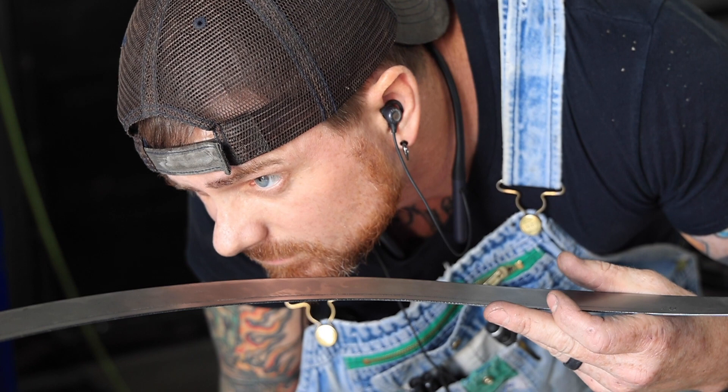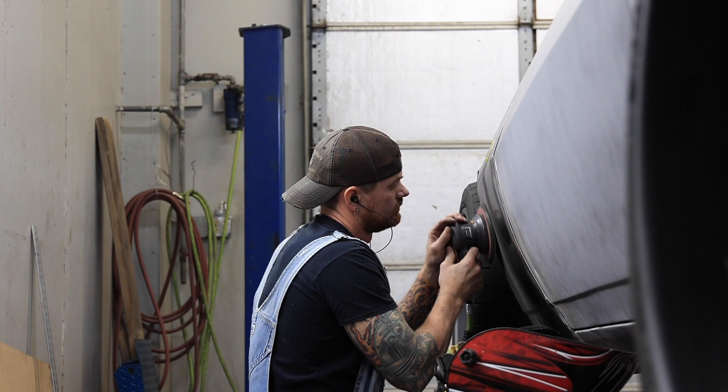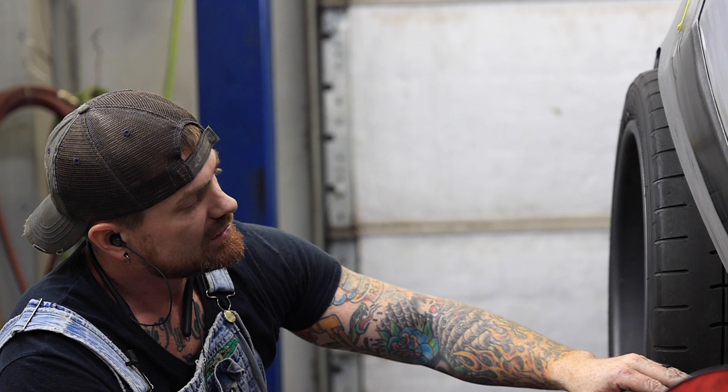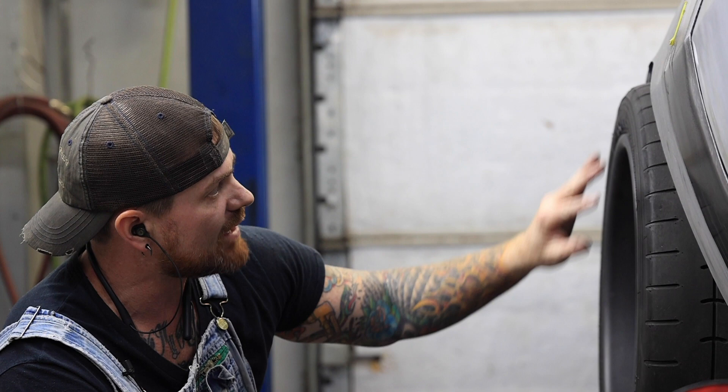I'm DA-ing the edge around where the flare is going to land so that when I get ready to weld, I can mark with a sharpie on bare metal rather than black paint. That way I can see my sharpie line really well, and I can also go back and forth from the other side to translate lines that mimic it. This also clears the metal so I can tack stanchions on to hold my lip out the proper distance from the tire.